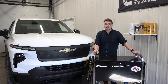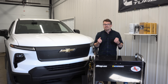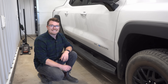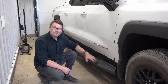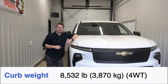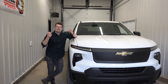That makes this an all-wheel drive truck. Now if that's not enough juice for you, the RST version is packing well above 700 horsepower and 700 pound-feet of torque. Behind the step here we have the larger 24-module 800-volt dual stack Ultium battery pack putting out 205 kilowatt hours. To put that in perspective, Ford Lightning's extended range model only has 131 kilowatt hours, so this battery pack is certainly pushing the envelope. This specific truck right here weighs just over 8,500 pounds — the RST version weighs closer to 9,000 pounds. So it's no surprise we have 8-lug axles, because she weighs just about as much as an HD diesel pickup truck.